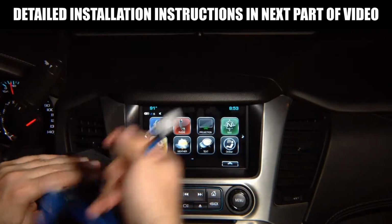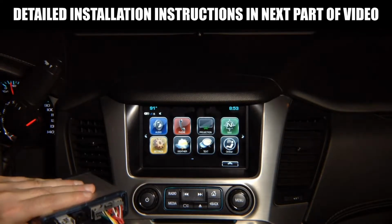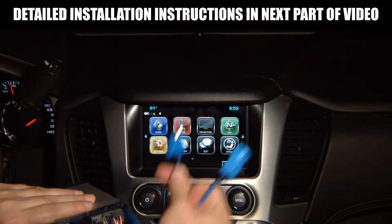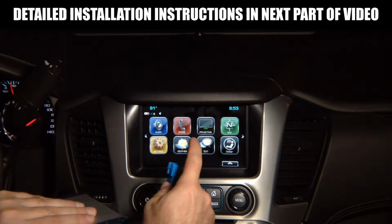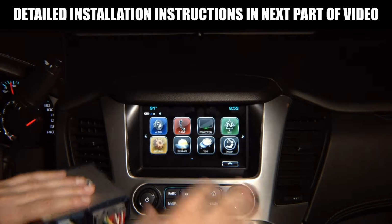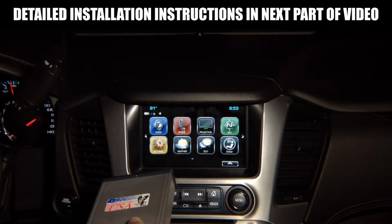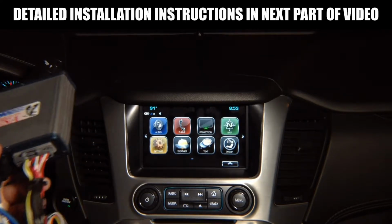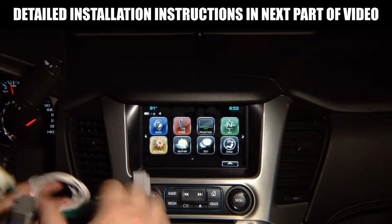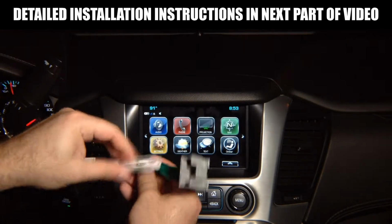And then you get these two digital cables that plug into the module, and they plug in. This plugs into the screen module, and the factory cable from the screen module plugs in here. This interface is installed at the screen module. There's plenty of space in any Buick, Chevrolet, GMC, or Cadillac to install this. So all of this is installed at the screen module, except this cable with a single pin is installed at the radio module, and it comes with a very long cable.